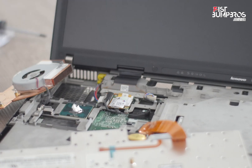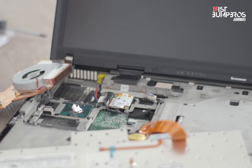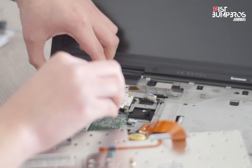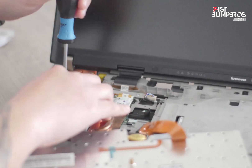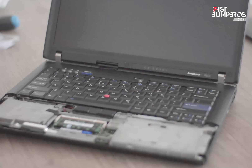Many people have their own ways of adding thermal compound to a CPU. This thermal compound came with a spoon-like thing which I'm not going to use. In my opinion, if you just add thermal compound on the CPU in dots and put the copper thermal component back on, it will just spread out eventually. I'm going to fast forward — what you'll see is just putting the R60 back together.